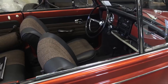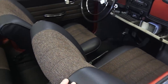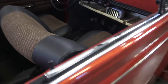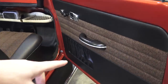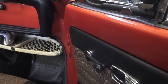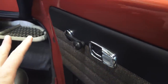Here's a really nice interior that we did on the 1970. Just so nice — this is espresso tweed with a black vinyl through Sofine. Sofine's black vinyl is not really black-black; it's almost like a brown-black, but it's dark and really really nice. Here's the door panel — I went with the earlier armrests because I don't like those big blocky armrests that came out in '68. I prefer the '67 and earlier armrests with the chrome trim. I also put the '68-'69 window cranks on because they have a little bit of chrome trim on them.